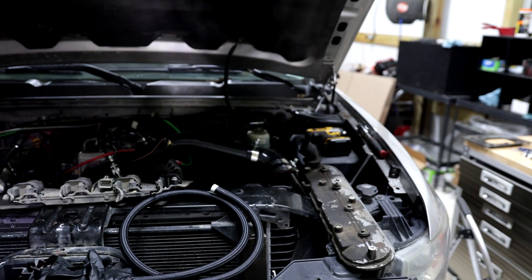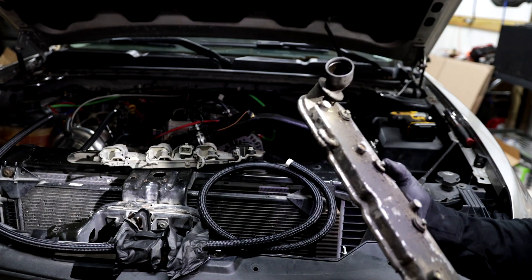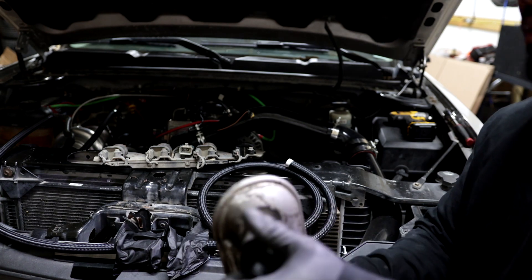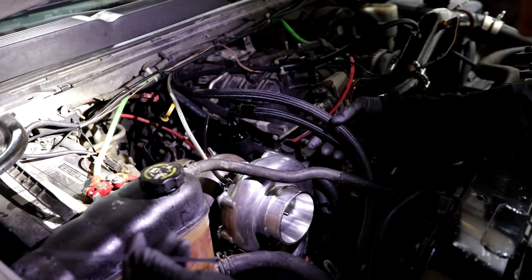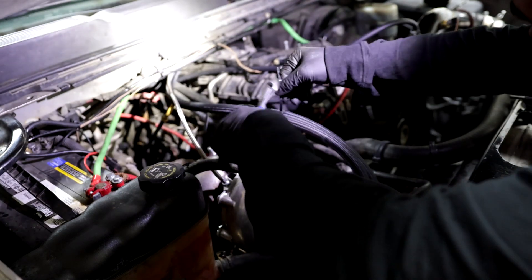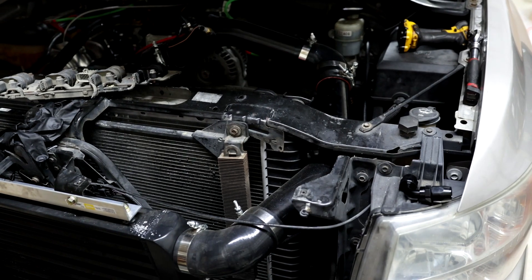And I swear to you, it doesn't run like it. Same thing with this side. I'm not going to clean the valve cover up or anything — I'll tell you why in a future video. Got a surprise — hint, hint. Screw the adapter in, simple as that. We got to keep it classy with some zip ties. If you guys want to use the catch can that I use, I'll put the link in the description. Now that we got the line done and the catch can is routed, all I got to do is put on the coil pack bracket and we are finished with our catch can mod.